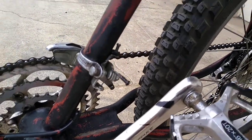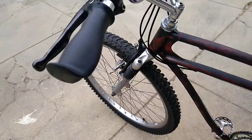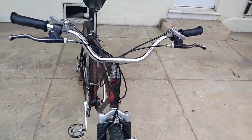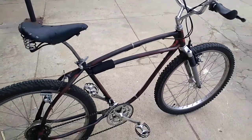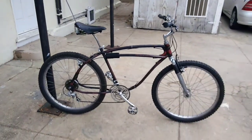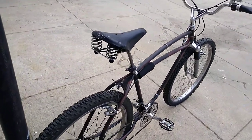There's your old-school cable end — not a cable stop, but to keep your cable from fraying you just use an old nipple off of a wheel. Gives you that period-correct look. And that's it — that's the bike. It's very cool, it's got a long top tube on it. The gussets — I designed the gussets, made the templates, and had them put in place by Chad Logan, Mr. Tick Bicycle Products. He did all the frame brazing on it. It's as cool as it looks; rides great, super comfortable — holds the trail on a downhill like you're on rails.